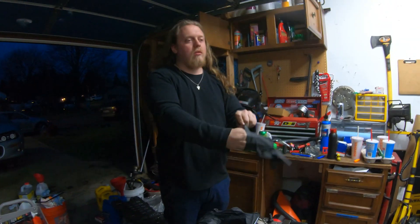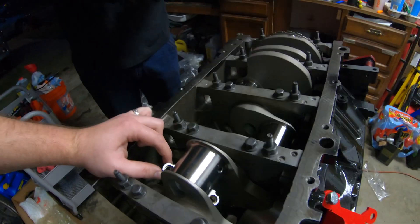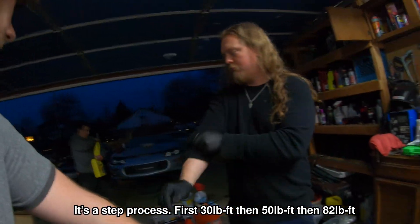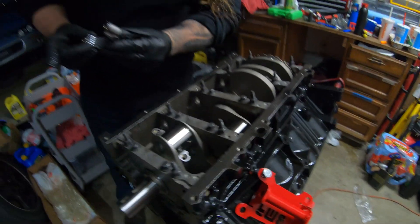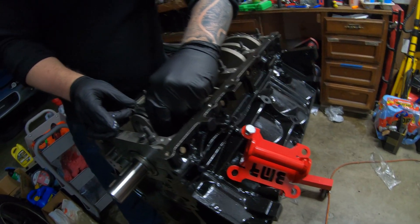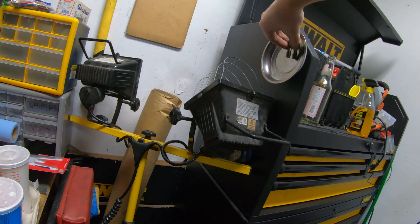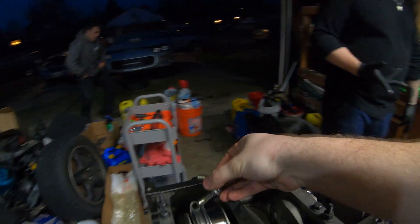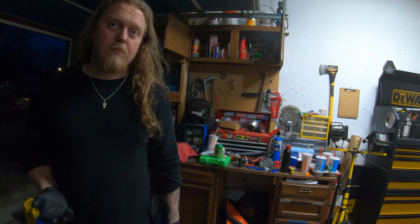One was good, so we're going to proceed. We have seven more pistons to put rings on and install. We'll get this lubed up and torque them down. Torque spec is 30, then 50, then 82 foot-pounds. The rod bolts have oil on the threads so they go in smoothly.